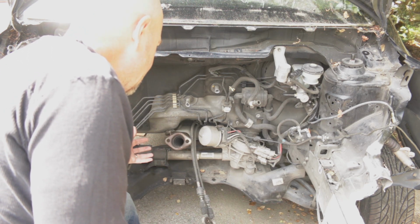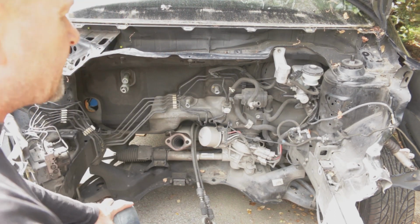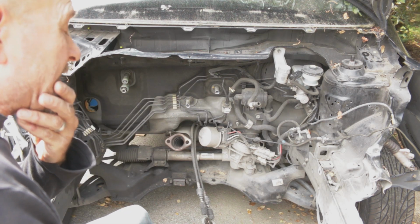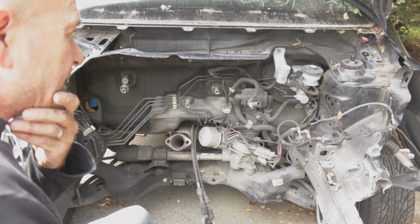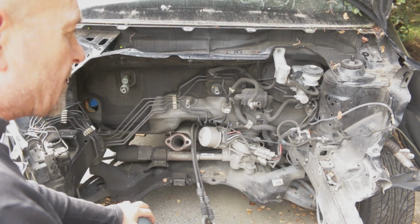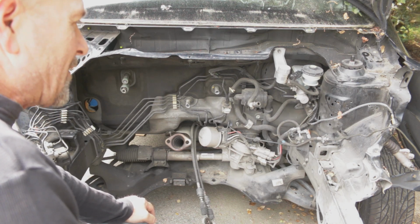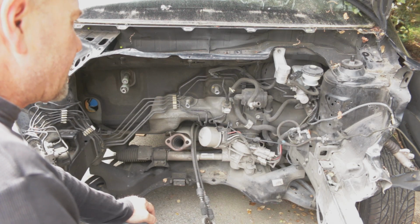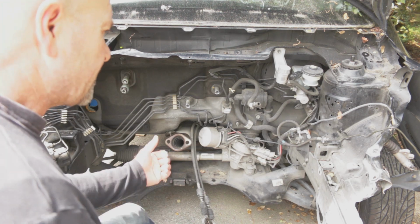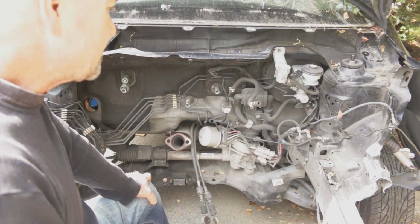I'm probably going to chop out a lot of this, and actually probably need to take the mounting points for the master cylinders and the brake booster from the Honda. I don't know. Yeah, I'll probably just use everything, basically almost use everything how Honda had it laid out. Because I don't have any space for the original brake booster in the Fiat, because that's going to be interfering with how the shifter cables come out and tie in with the transmission.